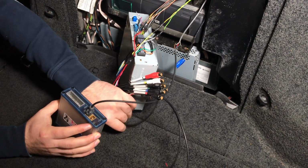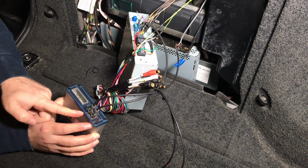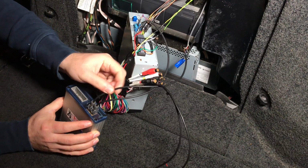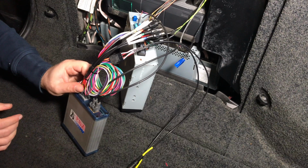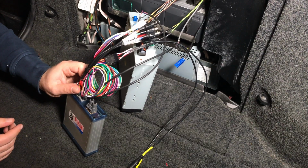In this one, you're going to connect the navigation side. This cable goes to the navigation. So keep in mind, the inside one, you got camera. So this goes to the screen and this goes back to navigation. Plug in the main cable and you're done with your installation. Go to the front, press and hold the nav button and make sure the interface activates.